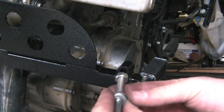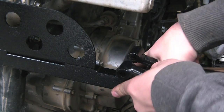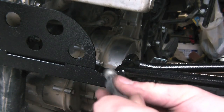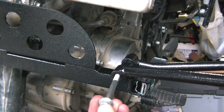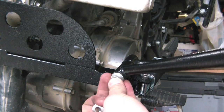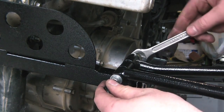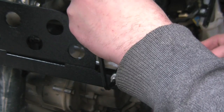The next step is to put the nerf bars on after we've gotten the radiator guard all secured. These nerf bars go on either side of the bike covering the fairings. We're going to take the 8mm bolt that is supplied, putting one washer on either side, thread it through, and put a nylock nut on the other side as well to make sure it doesn't rattle loose. Tighten that up but leave it a little bit loose so you can move it around while working on the bike.